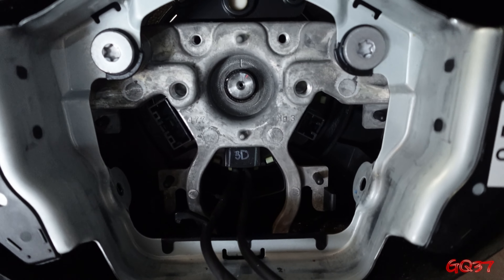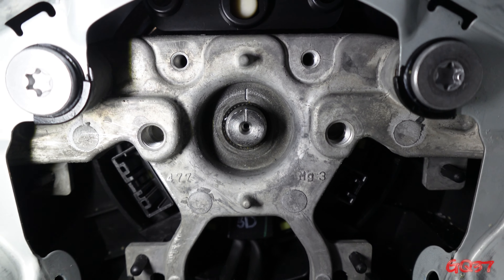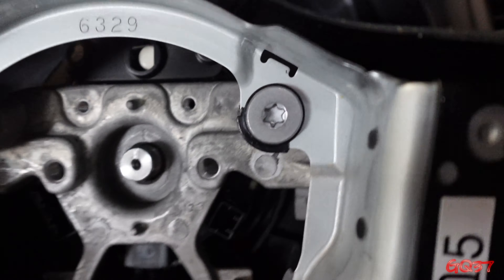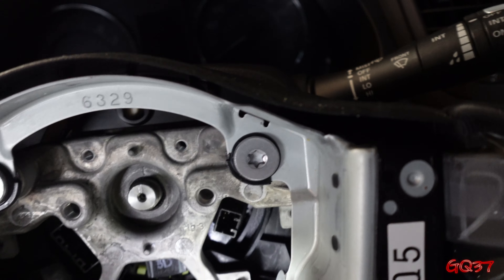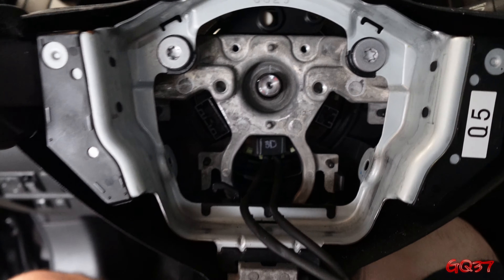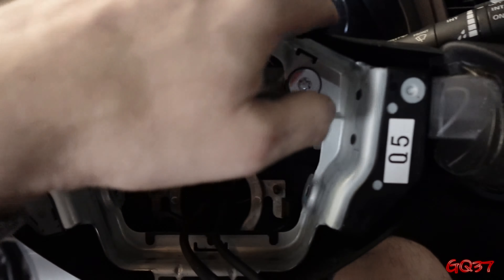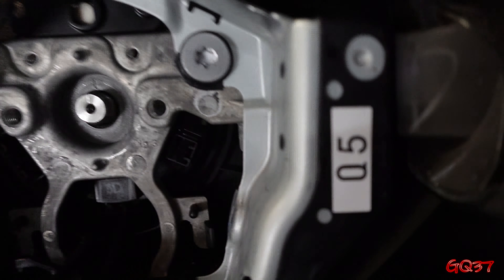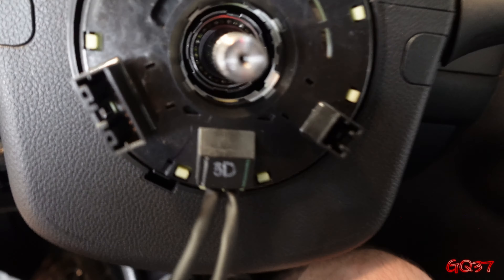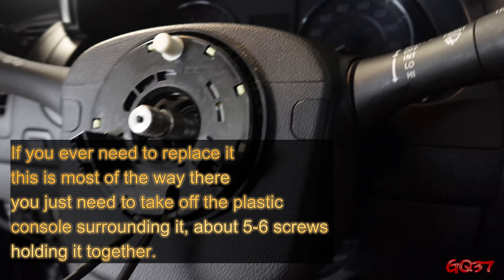Now you're going to see this line behind the nut — both lines are perfectly aligned: the one on the steering rod itself and the one on the steering column. They're both in the 12 o'clock position — that's the way you want it. When you put your new steering wheel back on, that's very important. Now we're going to carefully slide the steering wheel off of this rod, poke the airbag wires through that bottom hole, and then take the frame off of the inside and put it on the new one. This black round thing is your clock spring — do not spin it. It controls your cruise control and electronics on the steering wheel.